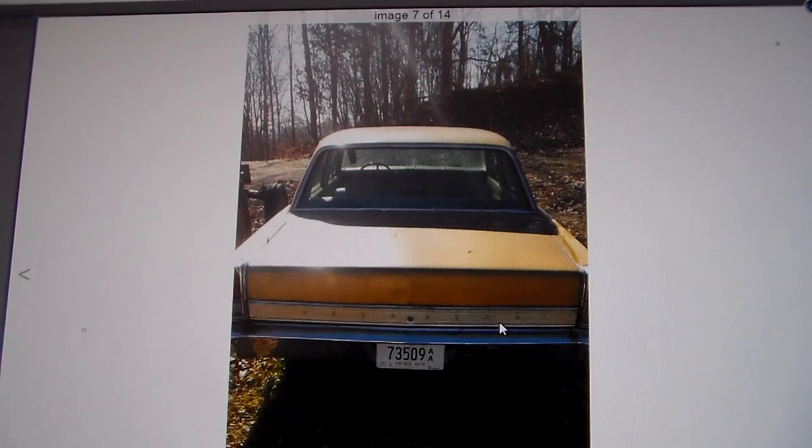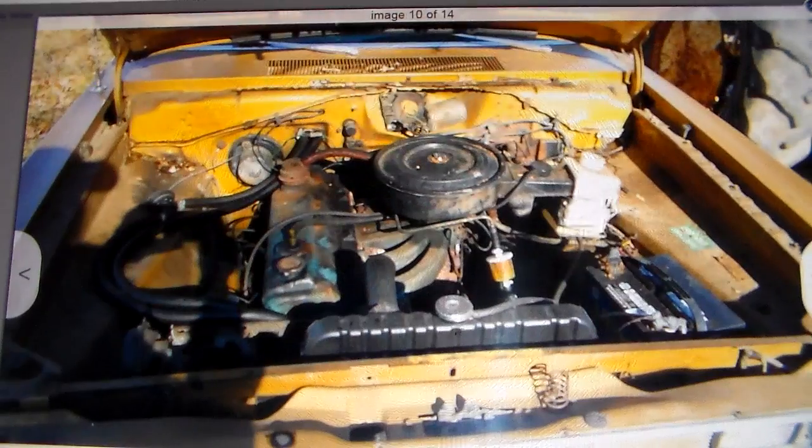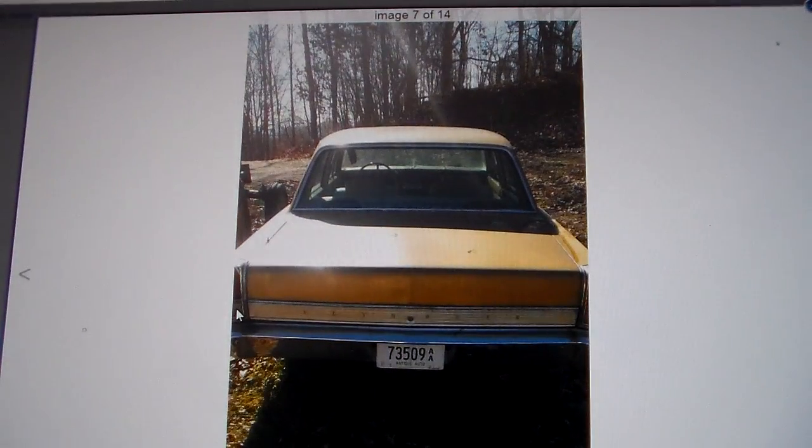If these things have a vinyl top, the tops have a seam right where they were brazed together at the factory. The seam was filled with body filler and they always rust right there — this one's got a little bit starting. Something's not right about the back of this car. It's either not a 71 or it's had the rear end changed. It doesn't have any reverse lights in the bumper — it's supposed to have those for 70 and up in the bumper — and somebody has put 69 taillights in it. This car was probably rear-ended years ago and they just used what they had.